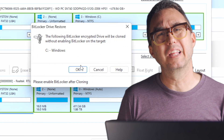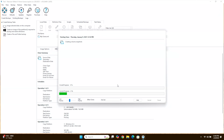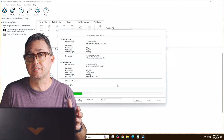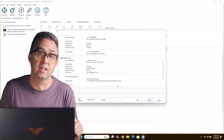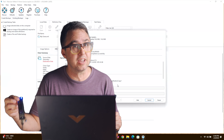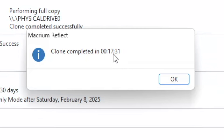At this point you can just hit Finish. It's going to talk about BitLocker not being enabled — that's an encryption thing that prevents people from physically stealing a drive and copying it. Just hit OK, agree to everything, give it a name, and it'll start copying over. Both of these drives are pretty fast. I did a Blackmagic disk speed test and the drive that came with this computer reads and writes at about 3GB per second, and this Orico drive can go up to 5GB per second. The whole cloning process for me took a little more than 17 minutes, and my drive was like 90% full.